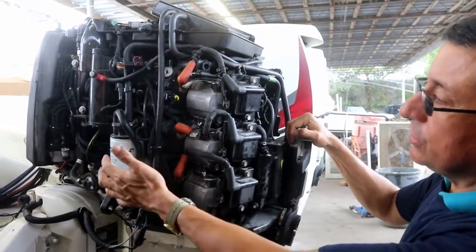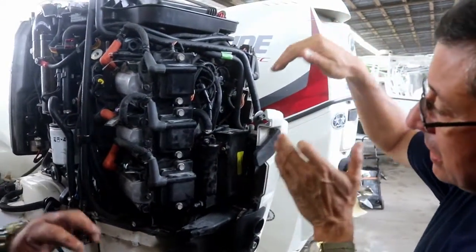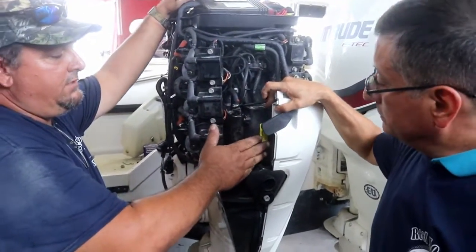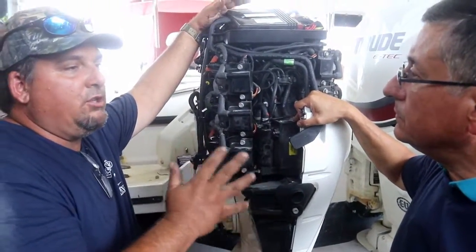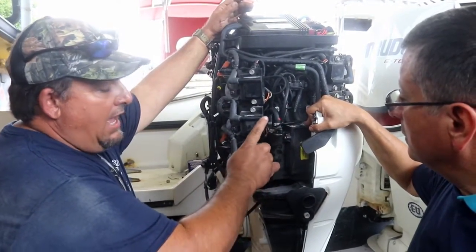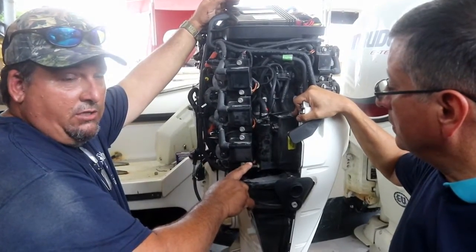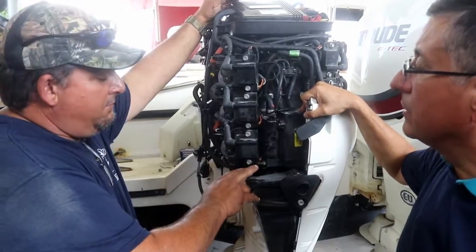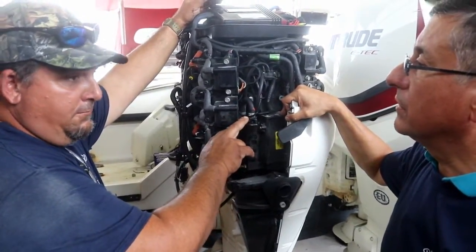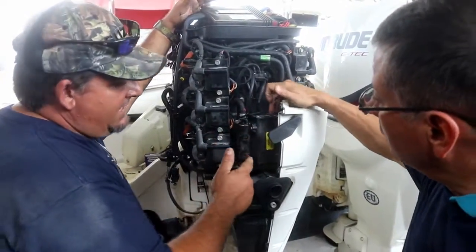Okay. Now we are going to continue. The fuel enters the secondary pump, and the secondary pump enters the high pressure pump. What about the high pressure pump? So the high pressure pump, what it does is it pressurizes. This one's between 28 to 32 psi. And so how this works is it's got two fittings. It has a high pressure fitting, which you can check your high pressure, and you have the low pressure that you can check the low pressure. Correct. Same thing, 4 to 7 psi on the low pressure side, on the high side between 28 to 32 psi.